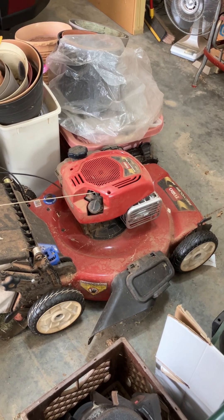We're going to get this carburetor and air filter installed and maybe pull the cord. I did install a discharge chute from my supplies — it's not made for this mower but it's good enough. Save discharge chutes when you salvage mowers because you can use them on others. I used the existing hole and drilled another, so it's nice and firm and safe to use — the original chute and cover were missing.